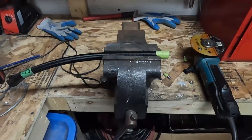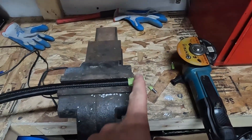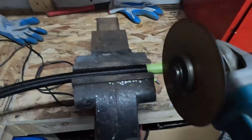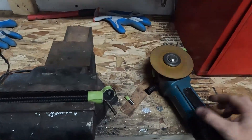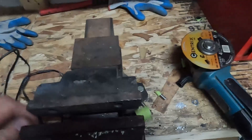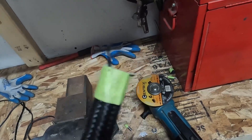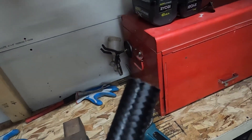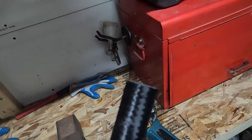First step is cutting the lines. One critical thing — because there's stainless steel braid in here — is to wrap tape around the line when you cut it to help keep everything together. The traditional way I've done this for years is with an angle grinder zip cut. You can see it worked pretty well. The end should be very smooth; if it doesn't look like that after you cut it, you're not ready to make the line.